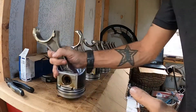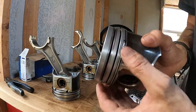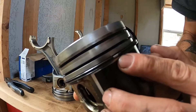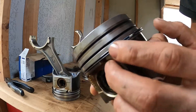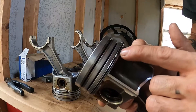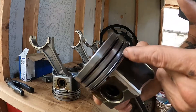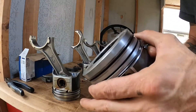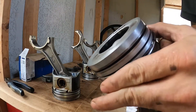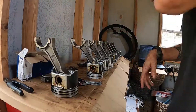Something that I noticed on the oil ring is the little metal springy one has some white paint on it. I'm guessing that they want that to be where your gap is on the ring, because I would say that that's the tightest area out of the whole thing. So I'm gonna guess that's where they want that opening on that gap. That's wrong.